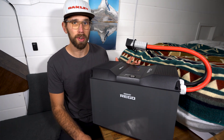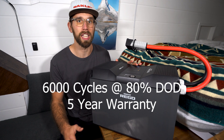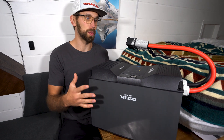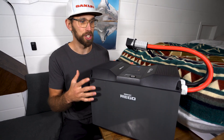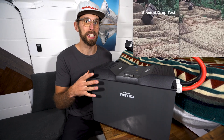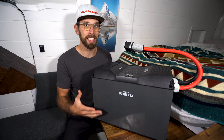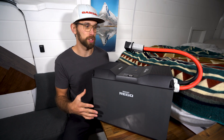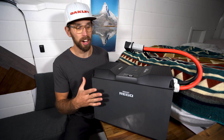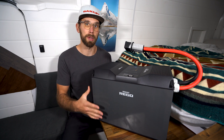The cells in this battery are rated for 6,000 cycles at 80% depth of discharge, which is pretty good when comparing to other batteries. When you're investing this much money you want it to stay safe, so it is inside an aluminum case, which is part of why it's probably so heavy. This battery is IP65 water resistant and also dust and vibration resistant. Renogy has definitely put a lot of extra care into making sure this shell protects the cells and the BMS inside of it.